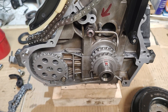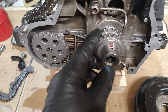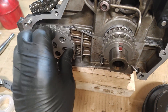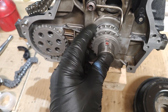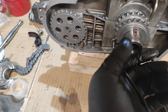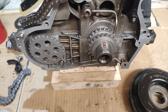I hope this video helps anybody who might get confused like I did. This sprocket spins freely - the oil pump is so easy to turn it doesn't need a Woodruff key, but if it ever came loose it wouldn't spin and your oil pump wouldn't work. The pressure from the crank bolt pulls everything together and locks it all up. Thanks for watching.